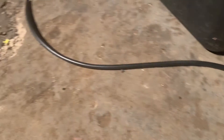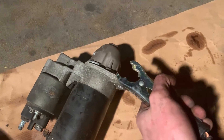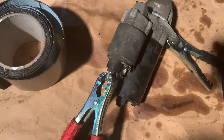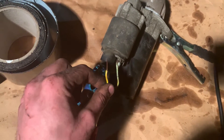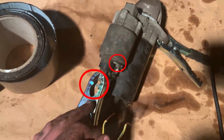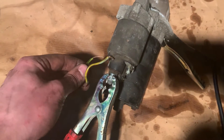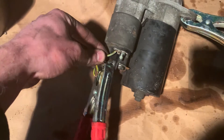The starter motor died on the BMW. I'm going to show you how to test if the starter motor is bad. Take the battery and connect the starting cables to the battery, then connect those cables to the starter motor — a ground and the main power like this. Now it should be enough in most cases to touch the bracket with a cable, but in the case of BMW it has two of them, so I made the cable like that.